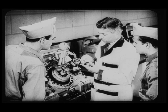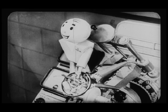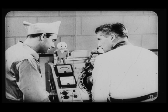Hope you men noticed that Carl wiped those new points with a clean cloth to get off any oil film. That's a detail you don't want to overlook. And don't forget to lubricate that cam to prevent rapid wear of the rubbing block. How does that resistance look now, Lou? Well within the 1/10 volt limit, Carl.